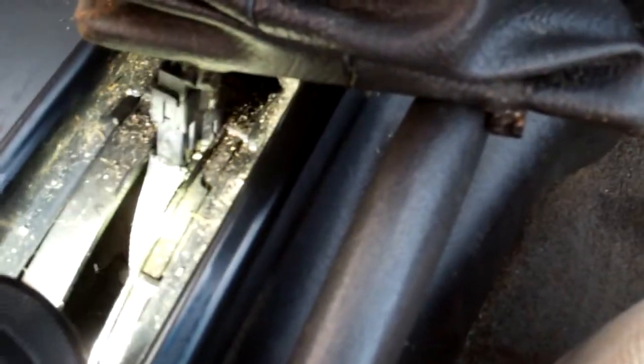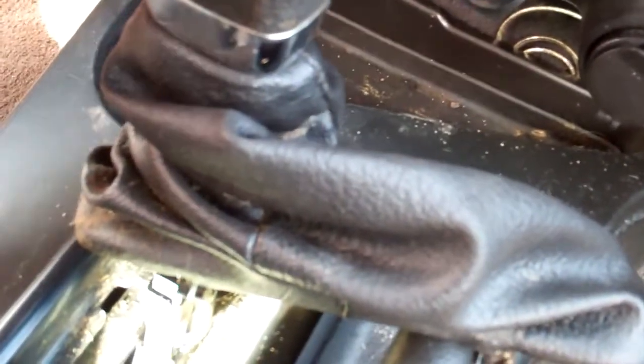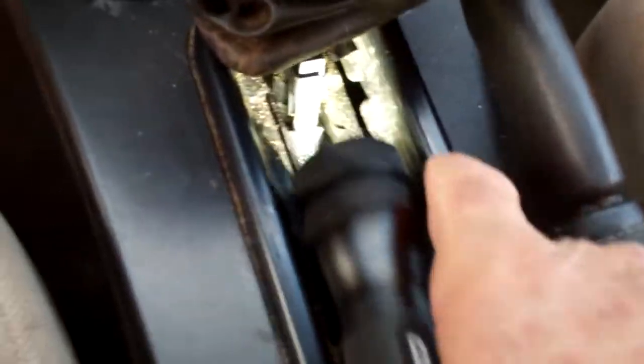Go down — I don't know if we can see that linkage. We're going around, I've got a light. Let's see if we can see that linkage when we operate it. Anyway, it'll wiggle — take a flashlight and take a look at that and you'll see it wiggling. Right down there where that's wiggling, right below that wire, is where we need to put a little bit of silicone-type lubricant.